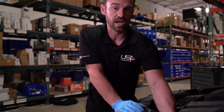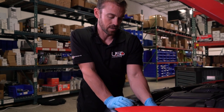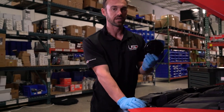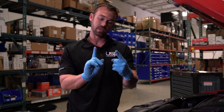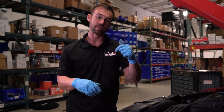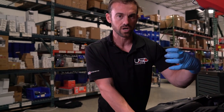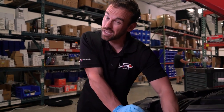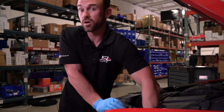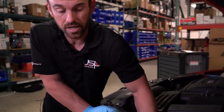The same process applies: take the light cover off by going counterclockwise, then reach your hand in blind. It's a long plug, and if you grab the outside you won't have the leverage because the plastic twists. Try to reach your hand in as far as you can and twist the actual base of it. Some cars I've had luck, some I haven't — this one I got lucky and was able to pull it out.